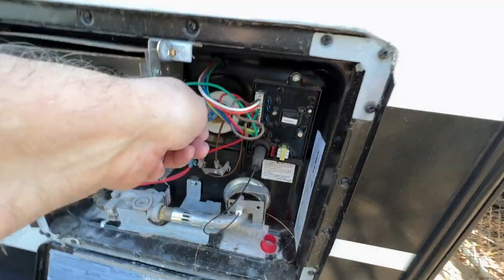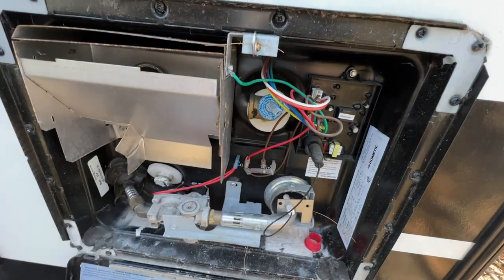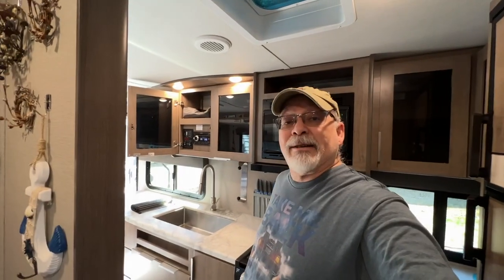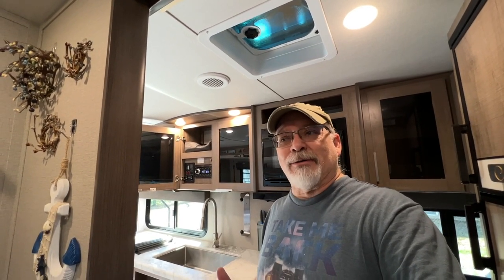We're gonna pop this valve a little bit here so that when it does fill, the air will escape from here. Now, honestly, this is the hardest part of winterizing and de-winterizing the trailer. When we first started, I knew I had to close certain valves to the water heater because you don't want the antifreeze going into the water heater. But I couldn't find those valves. I couldn't find where they were. They were well hidden, and when I studied, they said they're usually right behind the water heater. And I'm like, well, the water heater's under this cabinet in the back. How do I get to it?